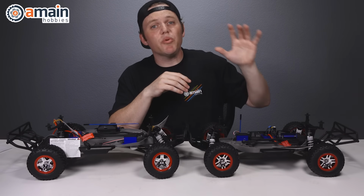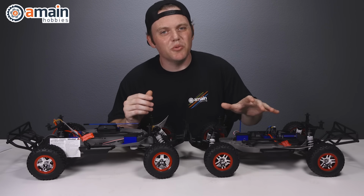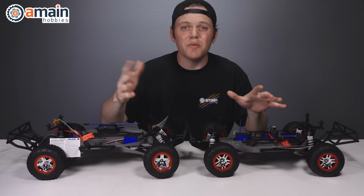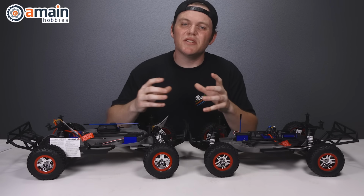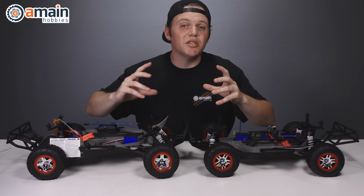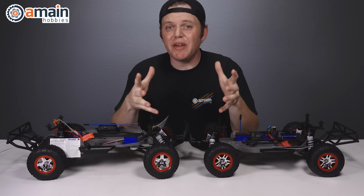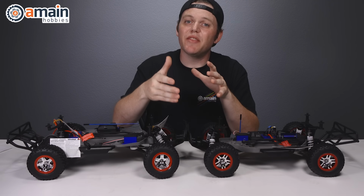A two-wheel drive model performs just great with those rear wheels pushing, but not in all situations. Really loamy sand, mud, the model just doesn't generate the same amount of traction, and that's why the rear tires will just end up spinning, digging out holes, and sinking. The same can be said when it comes time to apply the brakes.